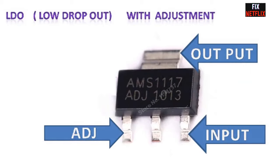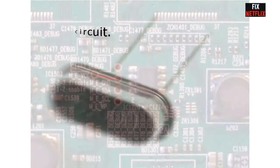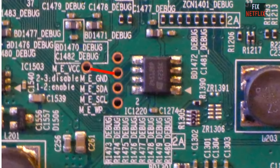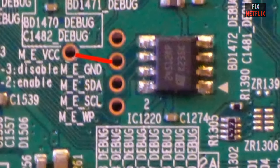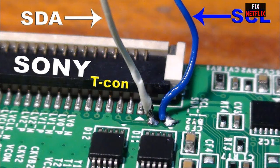The latest model TVs use a main chip or CPU/MCU built-in. Normally check the LDO IC and DC-DC IC resistor circuit for loop holes or problems first. If the TV mainboard LDO or DC-DC circuit can output normal steady voltages — 5V, 3.3V, 2.5V, 1.8V, and 1.26V — then you need to check the CPU reset circuit or crystal circuit. Also check the data bus lines SDA and SCL on the mainboard.